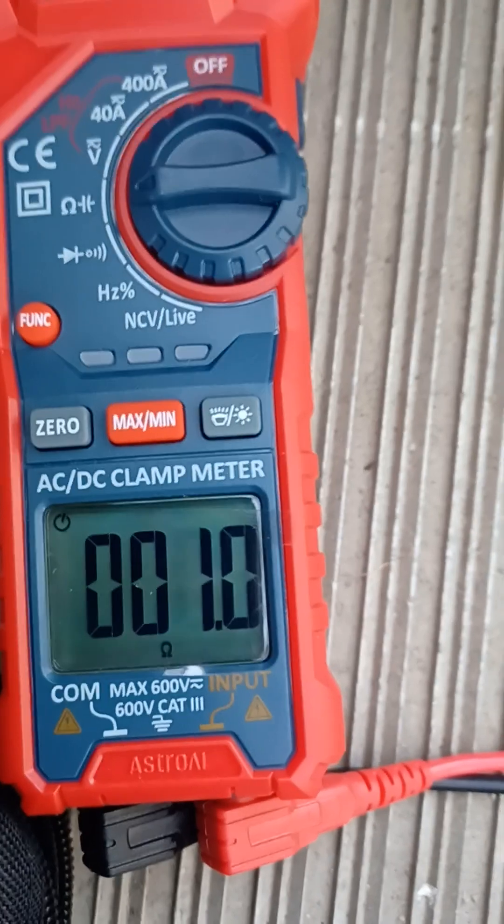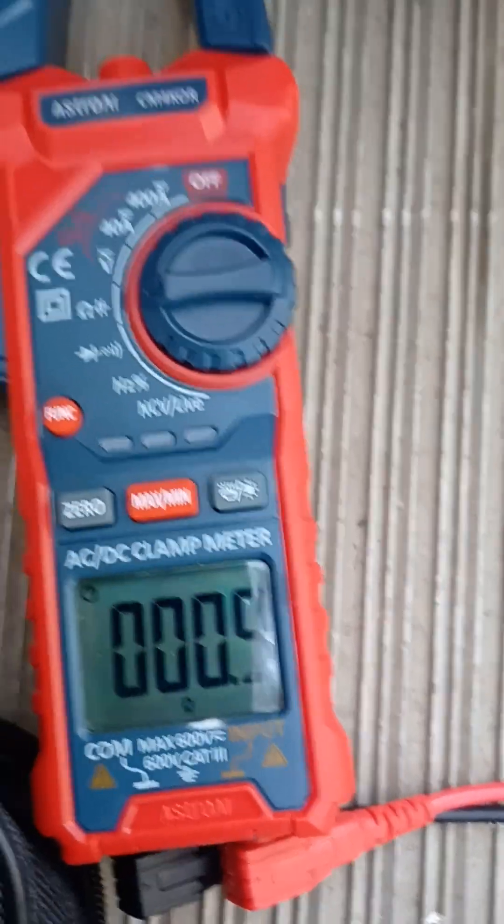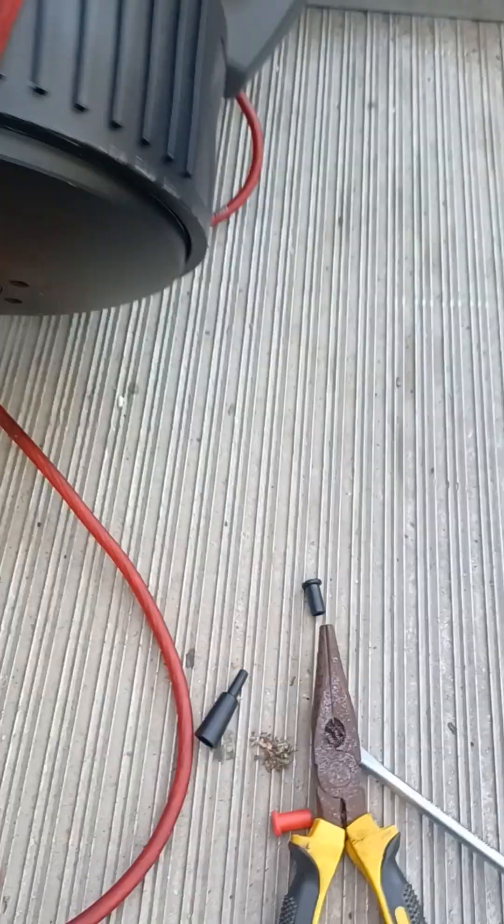Coil 2, coil 1. So we got black dot, black with the silver dot going into our pretend amp, and then our two solid reds going together to the amp — and it's coming up at 1 ohm. It's at 0.9 right now, basically 1 ohm, because my amp is 1 ohm stable. So I'm wiring them up and at the pretend amplifier it's 1 ohm. Now I'll show you the steps, just so you can see it actually comes out to the 1 ohm load.